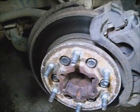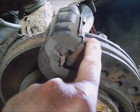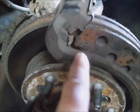And those brake pads are worn out. So I'm going to go ahead and take these 1/2-inch bolts out of the caliper, and set it up there. And I'm going to take these 21mm bolts out of the caliper hanger. The pads were stuck in these noise suppressing brackets, so they need popped off and cleaned out from behind them. It's closing the gap up on the pads and making them hang up. They wore pretty good though, I guess.